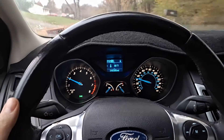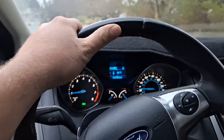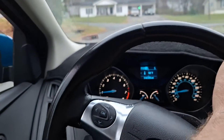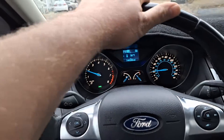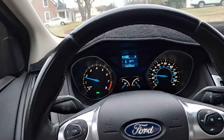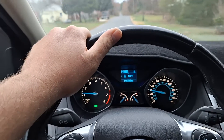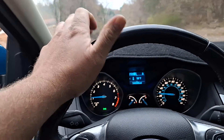My answer to whether an adaptive learn is required when you do a clutch replacement or replace a TCM: I'd say do what I did here — reverse and drive a few times until it feels like it engages a little bit better, and then drive it around for a while. See if it improves. If it doesn't feel perfect within a day or two of driving, then you want to stop by the dealer or a mechanic and have the touch point relearned, or get a scan tool yourself — probably not the one I got, though. It seems like there's an issue with that scan tool. I had good luck with it here and you may as well. I don't think it's necessarily 100% required — it just depends on how it shifts. It should be perfect; if not, it wouldn't hurt to do a touch point learn. Have a great day, thank you for watching.